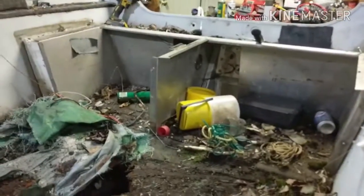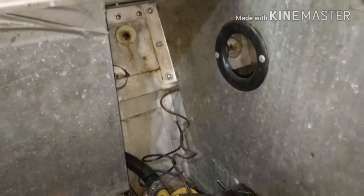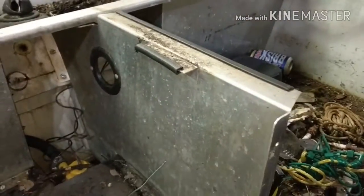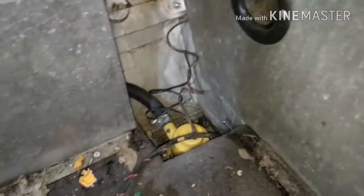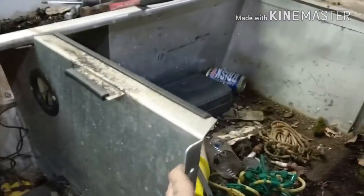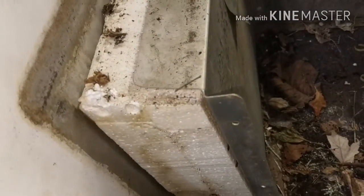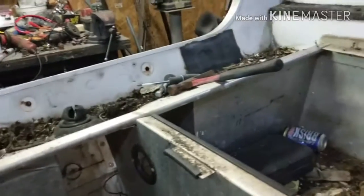I got the back off for the most part. The rest of it's all drill and rivets. It looks like this center bracket, that's a thicker chunk of aluminum, and it ties to this transom. See if I can get in there. It's tied to the transom and this back spill guard, splash guard. So it helps support the bouncing of the motor, and it bolts down to the floor. So there's some pretty heavy duty, thicker, looks like to be about 0.125 aluminum. A lot thicker than that stuff is. So we'll work on that tomorrow.